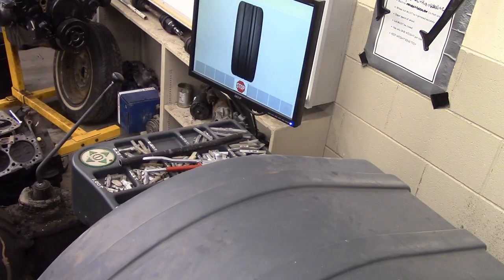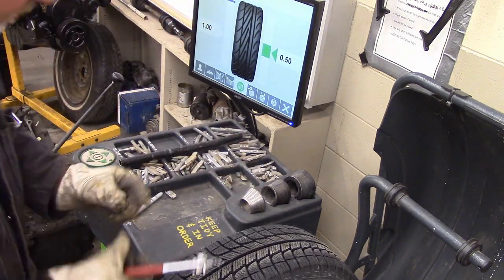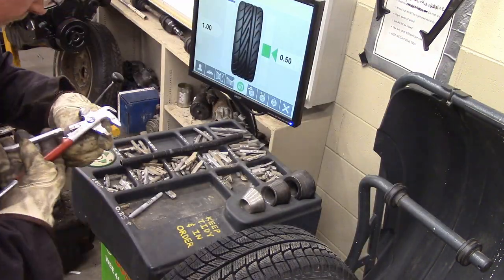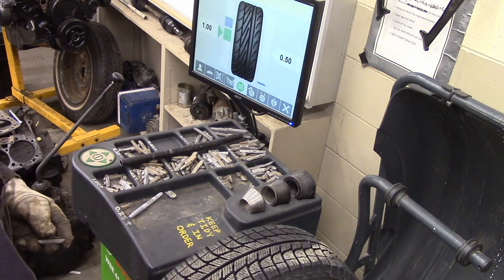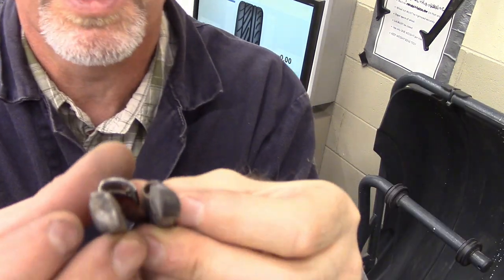Because it's the same size wheel, I don't have to change any settings. Sometimes when you spin it again, it'll ask for more weight to the left or right of the weight you put on. In that case, I usually just move the existing weight closer to see if it was just a rounding error.